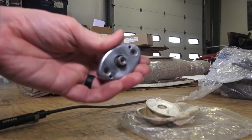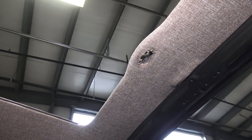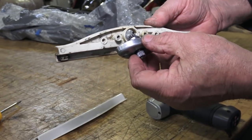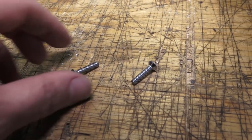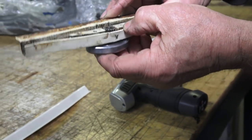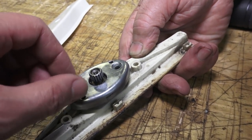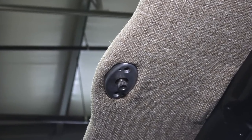Here's the center gear that the handle goes on and swings around. This gear is going to be held up into the headliner — make sure you make a small incision first and feel around where that hole needs to be for the gear; it's egg-shaped. Here's the top plastic that holds the gear in place. You want to use the longer machine screws with the tapered head, and those go into the plastic. The gear stayed in place because the padding around the headliner held it.